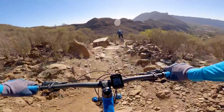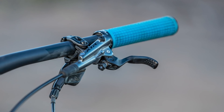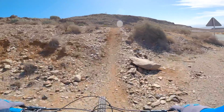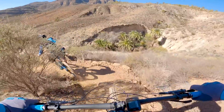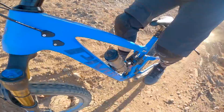It wasn't all rosy, however. The Shimano XTR brakes were a real disappointment. Despite feeling sharp with a consistent bite point in the car park, when I got to the trail that bite point just kept changing — every time I went to squeeze the brakes, the bite point was in a different place. To top it off, the Ice-Tech pads in the calipers rattled badly the entire time when the brakes weren't being squeezed.